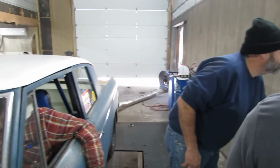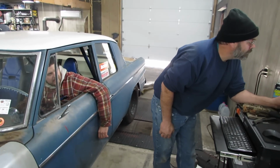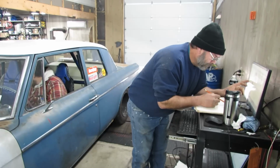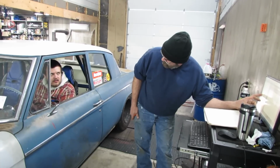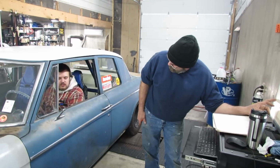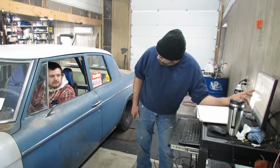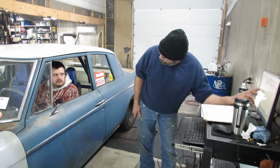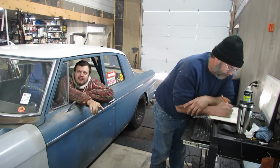Boost pressure, probably like 55. It starts deviating at 55? Yeah. Okay, so up to that point it was making less power. It was trying to give it angle, but it wouldn't go. It's not going to the angle it's commanding. It's giving it all it can, but it won't go. So there's a problem. It had zero angle that run.